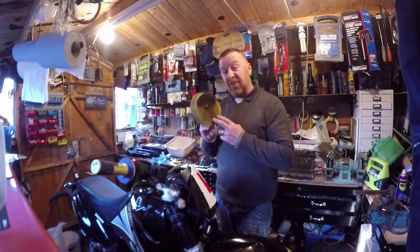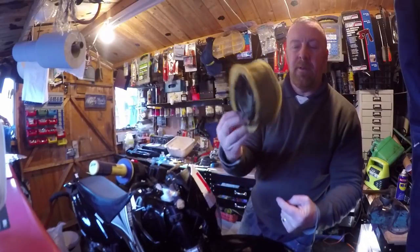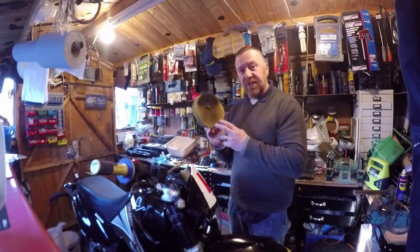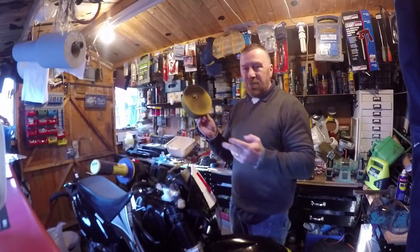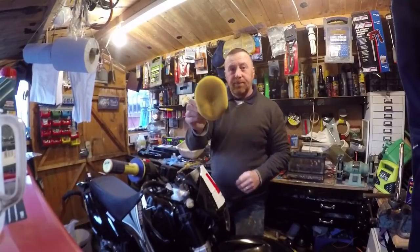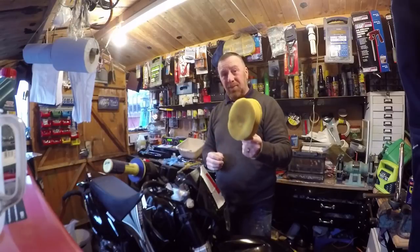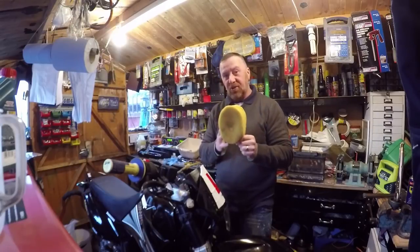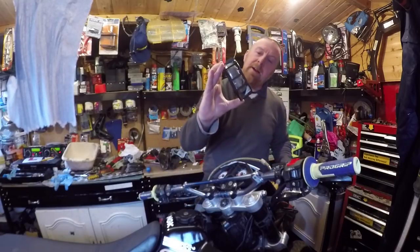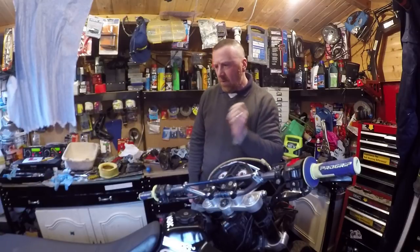When it comes to the air filter, these often get forgotten. They play a vital role in your carburettor for the air mix. With this one there's blacking here and obviously oil residue — it needs cleaning. You can save money just by washing this in good old washing-up liquid. Make sure it's completely dry and pop it back in — no need to pay £12 for another one. It's a simple thing to clean, and your bike is trying to breathe through that. How much cleaner is that — practically looks new. Little bit of staining inside, but nice and clean, no oil. Simple washing-up liquid, lots of hot water, rinse through, perfectly dry, ready to go back. Great money-saving tip. Let's put this back on — still going to give this a little bit of carb cleaner, pop it all back on. And now your bike will breathe a lot easier. No need to mess around with air-petrol mix now, hopefully. We'll see if it pops as well, because I don't think it will — it's not running so rich.